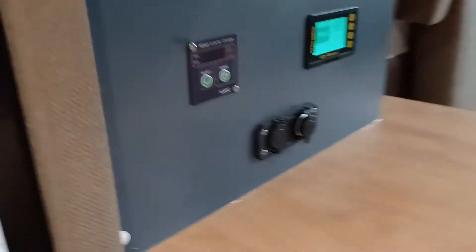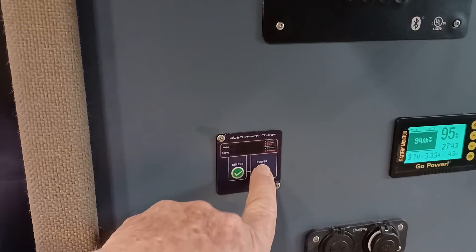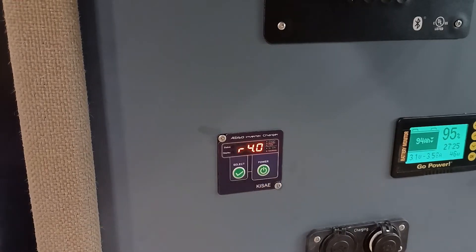If you look down here in the battery box, see the battery? You see that circuit breaker right there? It tripped — it says 'reset' there. I just turn it back on like that. You also need to turn the inverter on. Wait a few seconds. And there with the beep, the inverter is back on. So my next project will be replacing that breaker that we just reset.